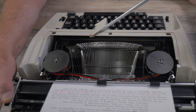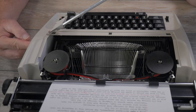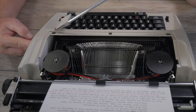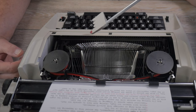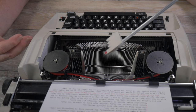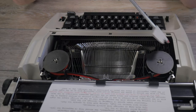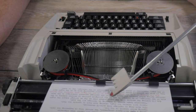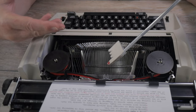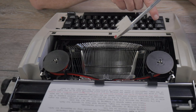A third possibility: spring motor tension is too low, so the carriage would simply be moving too slow. Also, this machine has an auto carriage return system — when you move the carriage it moves a drawstring turning a pulley on the right side. Maybe those parts are binding or dragging the carriage. Another possibility is the drive belt tension being too high, causing the type bars to operate too fast — faster than the carriage can move.